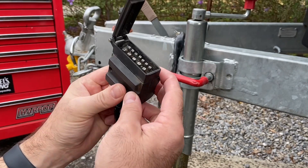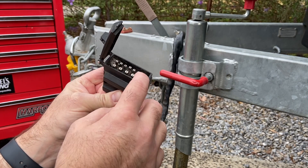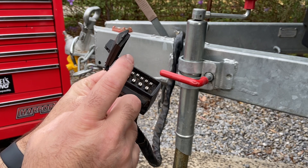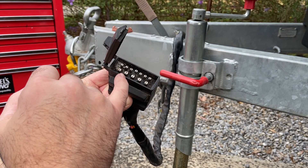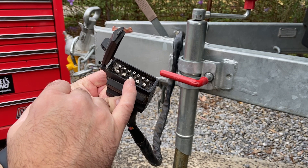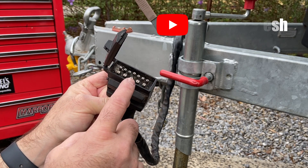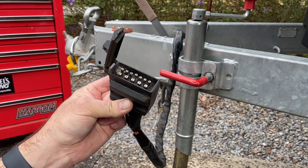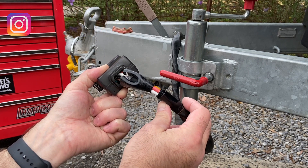The reason I'm doing this is to replace this with a standard 7-pin, but also these terminals up here charge up the internal battery. I'm also adding an Anderson plug, because these terminals only have a certain current carrying capacity whereas the Anderson plug has about a 50-amp capacity. My car is already wired up with an Anderson plug, so I'd rather put this to some sort of standard.